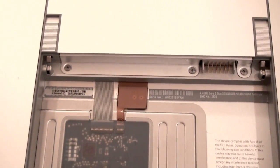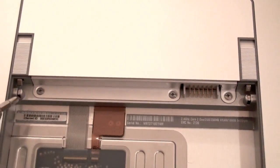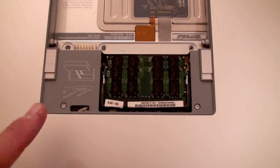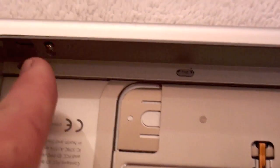The first step is to remove the battery, and then I'm going to be taking out these three screws right here. The memory door is out. I've actually rotated the MacBook Pro around and now I'm going to be taking out these screws in here.